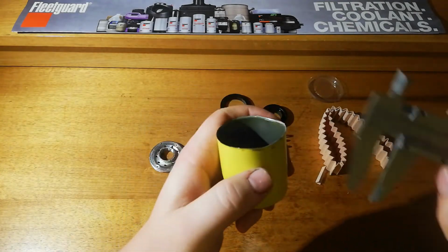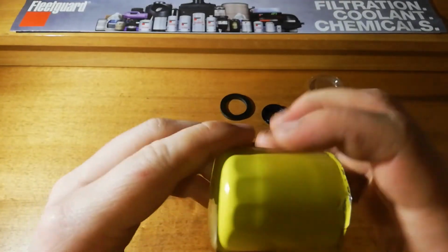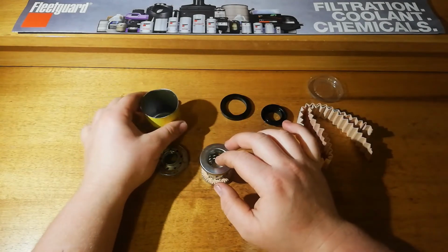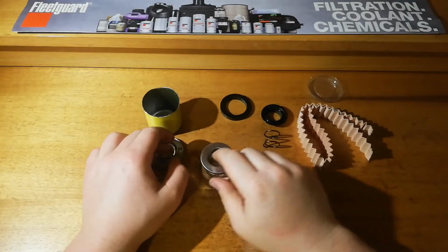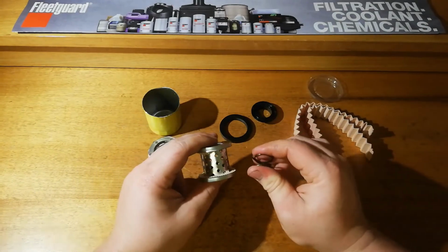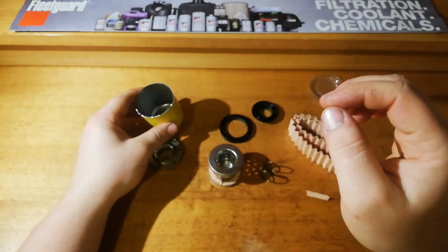And that can as well, that's up around the 1 mil mark, so that's very thick, which you'll want it to be because it's out in the open on the deck of a lawnmower. And I don't have any problems with this filter at all. It's very nice. Nice can, good base plate for the size of it. Absolute gold little canister. A big thick gasket, one that's well fitting, coil spring. I've seen a lot of these lawnmower filters with plastic cores and plate springs and all that, but here they made no compromise and it's a really good little filter. So there you have it, it's the Briggs and Stratton 795990 lawnmower oil filter.